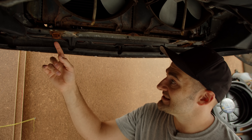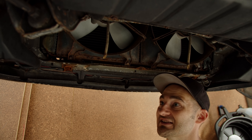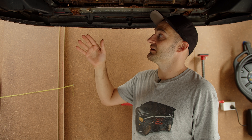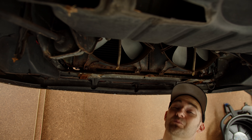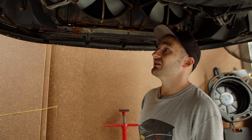I start at the front and work my way back. First thing you'll notice is rust — a fair bit of it, actually, under the front. So this was a Japanese car. This doesn't really happen to cars in Australia like this. We don't have salted roads and we've got basically no snow. There's a good chance this has had the front bumper parked in a snowbank at some point in its previous life, and that's just enough to start this corroding and then time has finished it off.